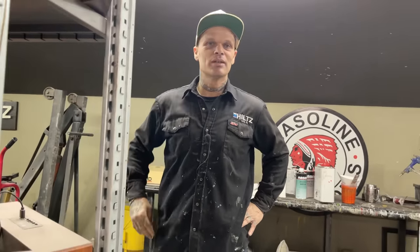But anyways, this is what I'm thinking about doing. When I tape it off, I will tape it straight so it looks straight. I'm not going to put any fill in this, because it just takes time, I don't feel it's necessary, and I think I can fool the eye with taping it off. So what I think I'm going to do is paint this outside here black, and paint inside here white, and then we'll probably pinstripe it with the Calypso Coral. So white in here where the louvers are, black out here where it's lifted up, but when I tape it off, I will tape it so the lines are straight, so it'll fool your eye. So when you look in there, wow.